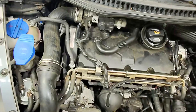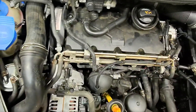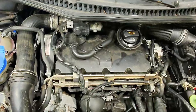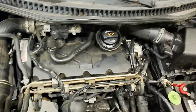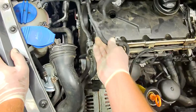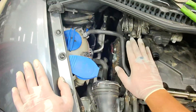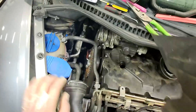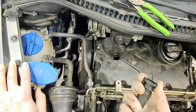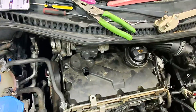We're gonna go ahead and remove this hose here, get this harness disconnected and moved out of the way, and also remove this charge pipe so we can get the cover off. We got our charge pipe removed and harness unplugged and unmounted. We removed the hose going to the valve cover and also removed the plastic cover — it just has two little tabs and pulls right out. The hose pulls out with the pins, and there's a clamp on the other end.